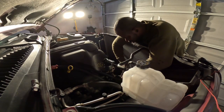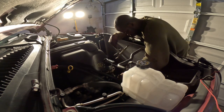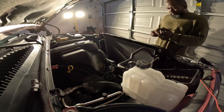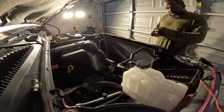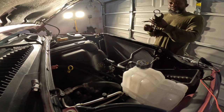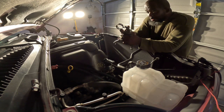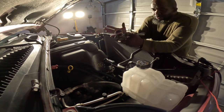So we're putting these big cooler lines on. Everyone knows, just did the little radiator hose. What you gotta do for these things so wide? And you can't get them closed. Well, if you close your pliers up more, they ain't gonna be wide enough to get around it. So you get it wedged in there and you just start tightening the knob up, so that way when you lock down on it, it opens all the way up.